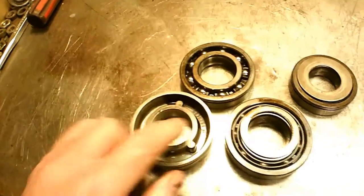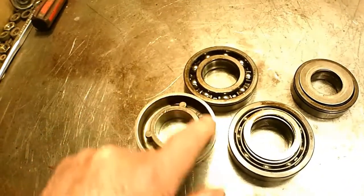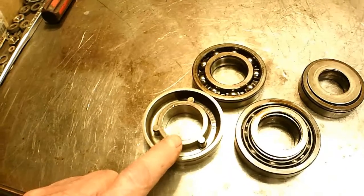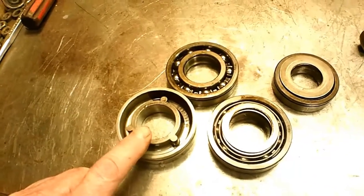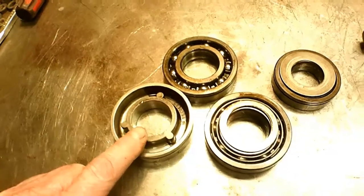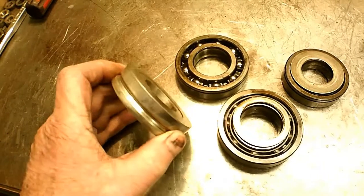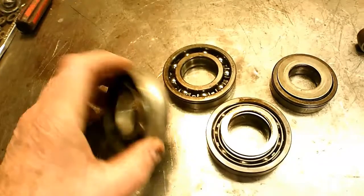Because of all this area — I can measure how many cc's this is in here with a bottle — but that's what they're trying to get rid of, as much cubic centimeters as they can in the crankcase, and therefore they'd have a stronger charge going into the cylinder. But it's not really worth that kind of effort, I don't think. It probably does give them a little bit more horsepower, but for what it does to these bearings I think is nuts.